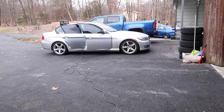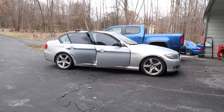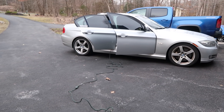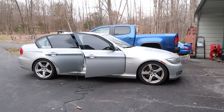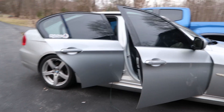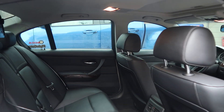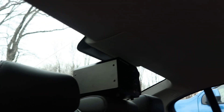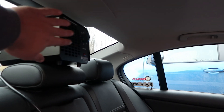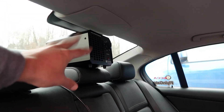I've got some extension cords going to my wife Jane's BMW 335D. She was just commuting in it and her place of work did come out with a case of COVID-19, unfortunately, so we're going to disinfect just to be sure. I put the ozone generator as high up as I possibly can with the business portion pointing out, because ozone tends to sink — it's heavier than air and wants to go down into the foot wells. If I put it down low, it may not get all the way up top. So put it at the highest spot possible.